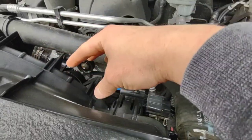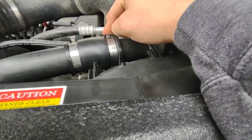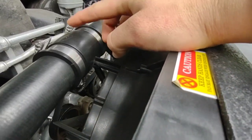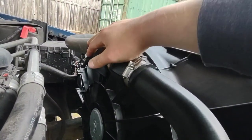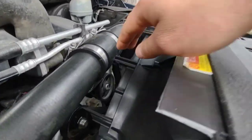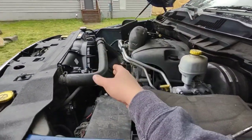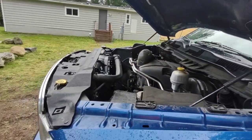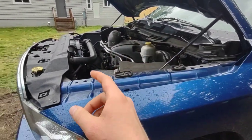One of the pins goes back to the fan — that third pin is a surge protector so when the fan kicks up and has a voltage spike, it does not blow a fuse. I had to put something over this piece so it wouldn't cut through the hose; I've trimmed it down some, but overall this fan is literally just bolt-in. It slides right in, everything plugs right up — it's a plug-and-play system, 100% usable on this truck as long as you adjust the temperature that it turns on at.